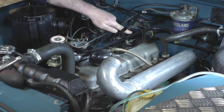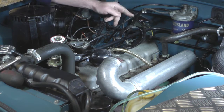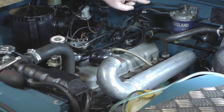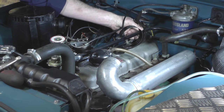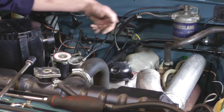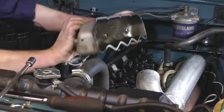Then we can lift out the rocker cover. On the early original Land Rovers, the heater pipe bracket at the back was actually fixed to the pipe, so you'd either have to bend up the little bracket or drain the water and remove the heater hose from the heater box to move it out of the way. But on this one it's a flexible one, so we can just spin it out of the way. With the three nuts off and the heater hose bracket moved, it's just a case of lifting out the rocker cover.